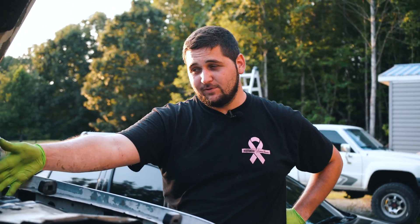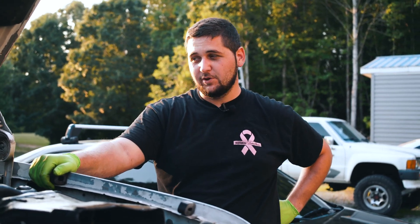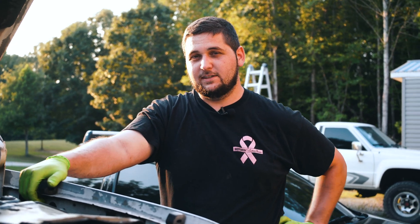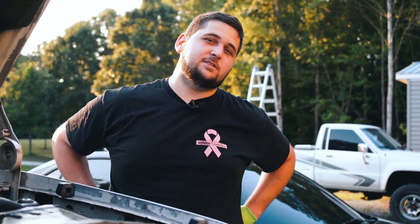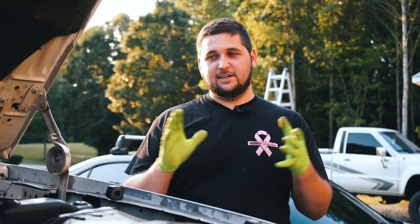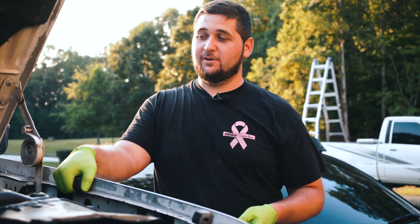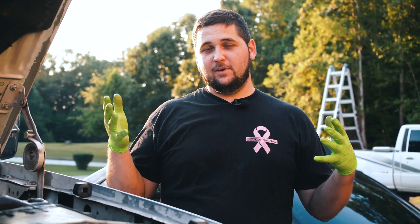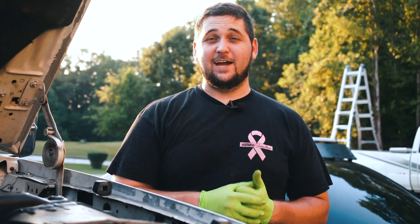That's how you check your fuel pressure on a 7.3. As you can see, it still ran with 10 psi, but I doubt every 7.3 is going to be like that — this one may have just been a fluke, but like I said, it was running pretty rough. So that concludes how to check the fuel pressure on a 7.3 Power Stroke. This is for the '94 through '97 7.3 Power Strokes with the mechanical fuel pump that runs off of the camshaft. Hope this helps some of you guys out there working on your 7.3. I know there's a lot of you out there — these things are still on the road, they go a long ways. They're very good trucks, but a lot of you are probably working on them now because they've got 500,000 miles clicking up and a lot of stuff's starting to go bad. Anyway, hope you guys enjoyed this video — please like and subscribe, and see you guys next time.